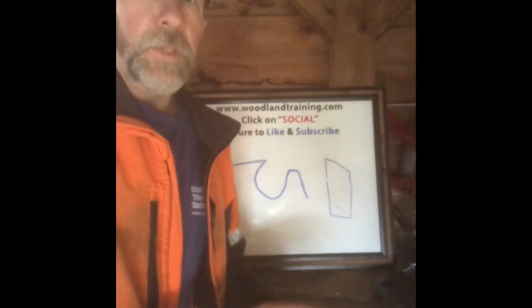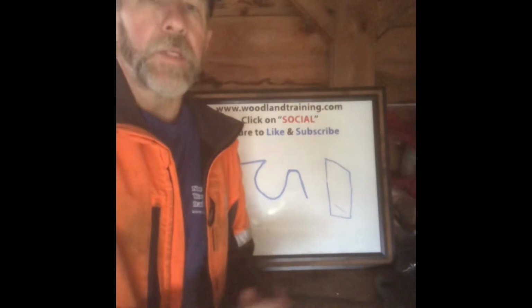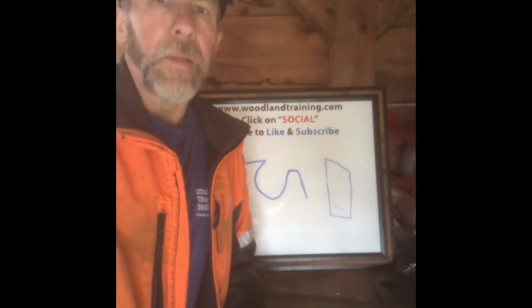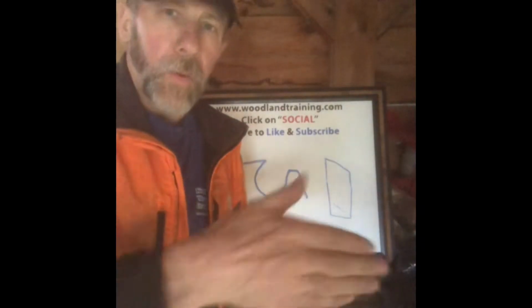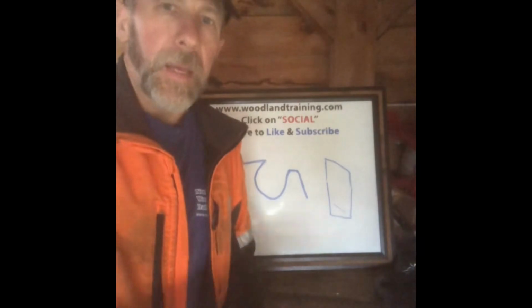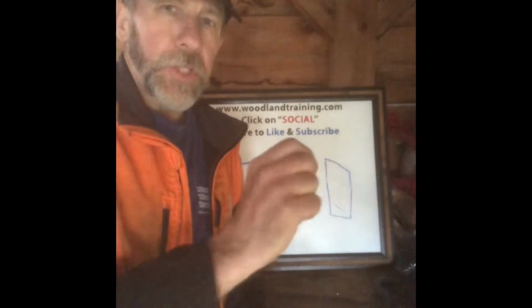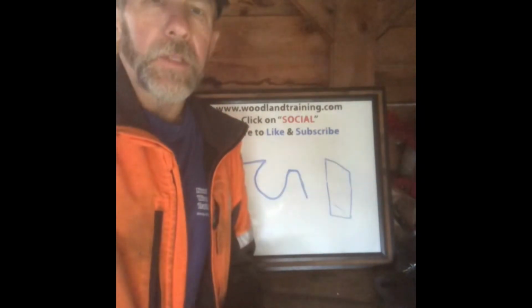With that said, let's throw some numbers out there just so we've got some sort of a baseline to reference from. Let's, for example, say we've got a 20-inch bar on our saw, and we're in the middle of a 20-inch diameter log. Full bar, making contact, all those teeth, right, as it's traveling along, and I know they porpoise along, but you get the idea. We're at that point in the log where we're asking the engine to maximize that horsepower, but we have to keep that RPM up into that 10,000-ish RPM, right into that power curve. So the thickness of each chip being made by each one of those teeth affects how much power it's going to take from that engine.